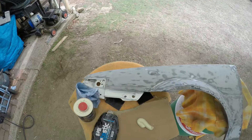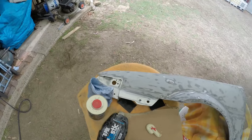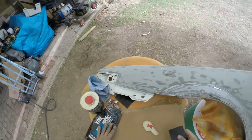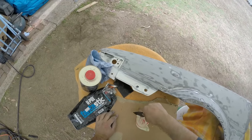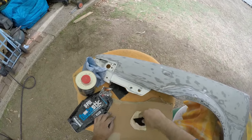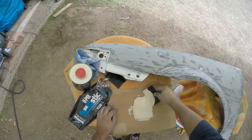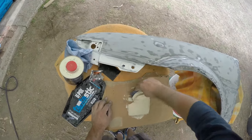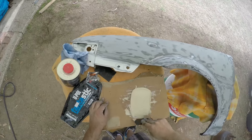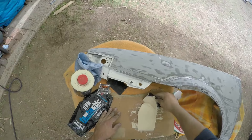I'm obviously mixing up my own filler here. As a general rule, you'd want to mix a pea of hardener to a golf ball of filler. I'm using Upol Fantastic filler — it's the one I like using most. I think it's really easy to work with, it's got a good work time, and it has more of a moldable consistency while you apply it, unlike other fillers I've used in the past that had a runny consistency. I just like to mix it on a piece of scrap cardboard or parchment paper that I can just throw out, and all I'll have to do is clean my scraper after.